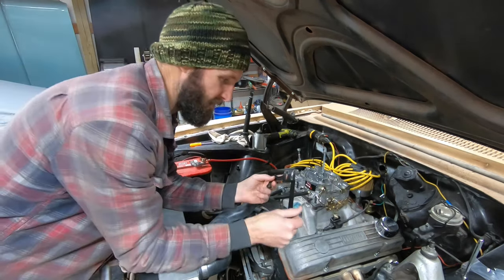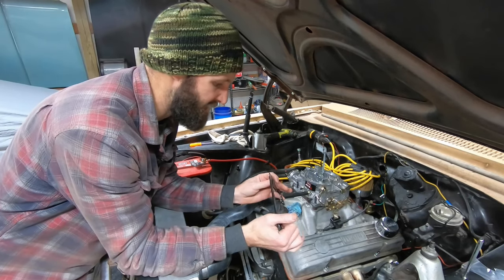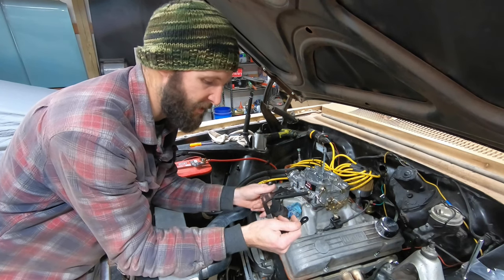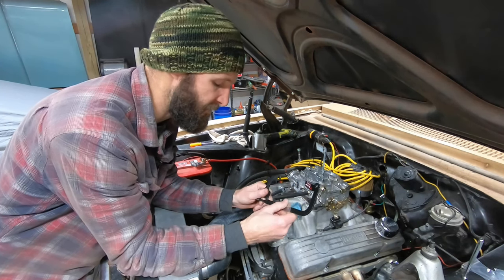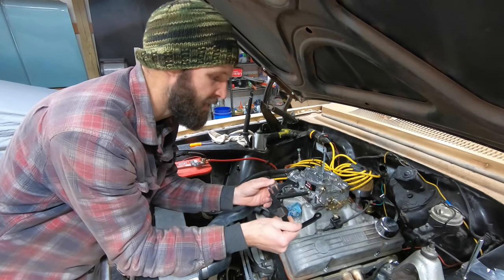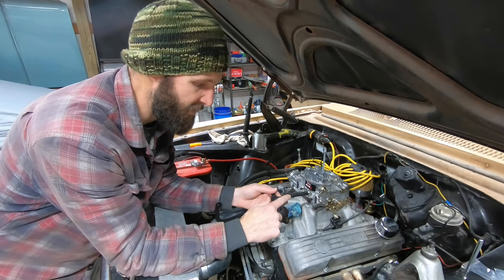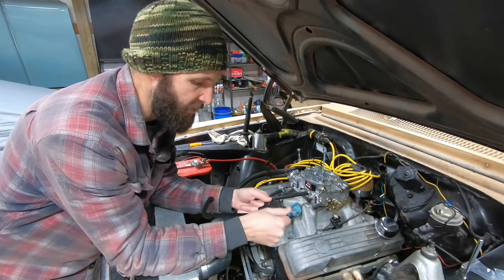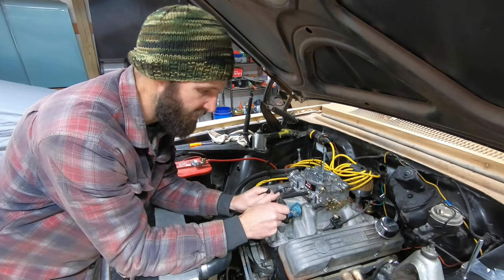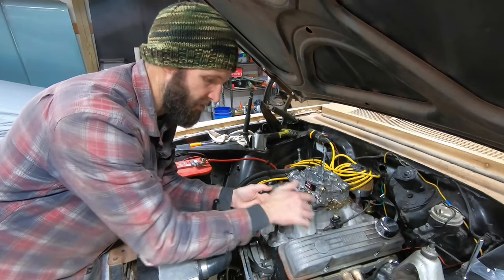The welder I was using was a little Lincoln 110 weld pack. It doesn't have very many settings that are adjustable. It's a flux core machine. It doesn't do a whole lot of quality welding. It just doesn't have the capabilities. But it'll do stuff like this and get it done. And if I clean this up just a little bit more with a good little file that can actually get in there and round those edges, break these edges a little bit and throw a coat of paint on it, that would actually look, you know, semi-finished.